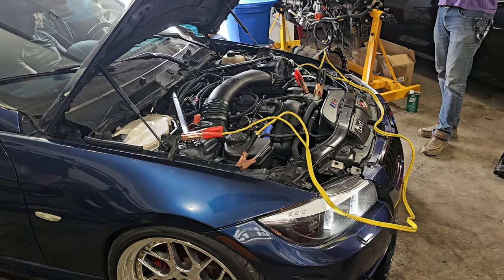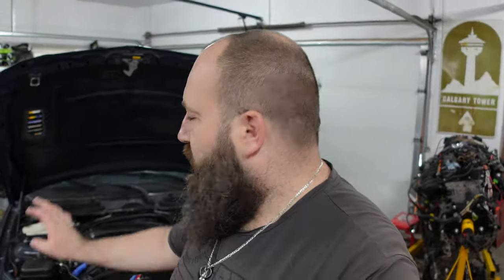We checked all the connections, we changed the harnesses, we changed all the relays, we changed the EKPM, we did all of the diagnosing. Read that maybe it was a bad ground. So the factory ground, even though it's a braided line, we took off, we cleaned all of the surfaces, we bolted it back and it was still a problem. We even tried to give it extra grounds because the oil filter housing was connected to the block. So we used some jumper cables to give it a bit of a ground. So we connected them to the filter housing to think maybe it was a grounding issue. Bad brain. Nope.